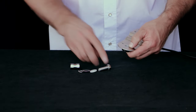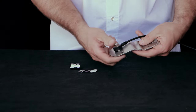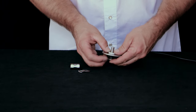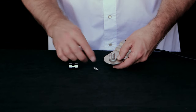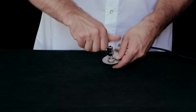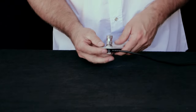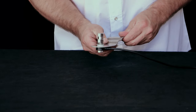We'll run the bolt through — the bolt is a positive connection because it's touching the positive portion of the coax cable. On the opposite side, you first have the other nylon washer; make sure the lip of that nylon washer is also facing down. Then you have your flat washer, lock washer, and double sided nut. Thread those all together and make sure that the lips of both the nylon washer and the coax are seated in the hole properly. That's it mounted on the underside.